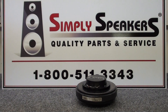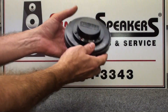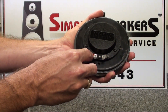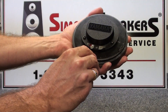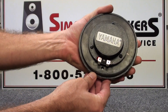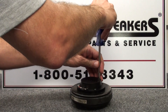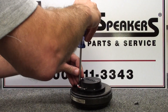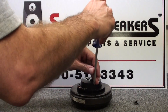It's a very common part, and in this case a very simple installation. We start with a Phillips head screwdriver. Before we remove the old diaphragm, notice that we have a positive connection already marked on the diaphragm, and there's a little round hole in the top plate of the magnet structure to indicate where the terminal goes. If you pay attention to that, you won't have any issues installing the new part. The first thing we'll do is simply remove the three screws for the old diaphragm. We'll set those aside, as we'll reuse them to mount the new parts.